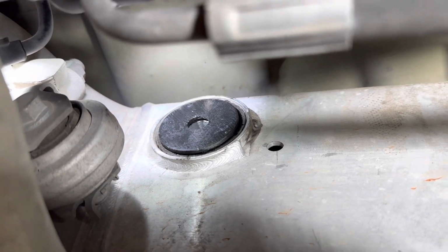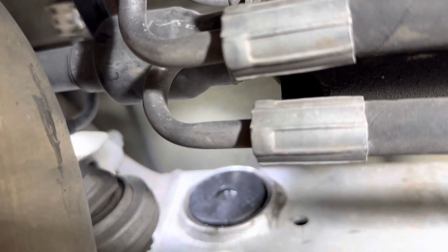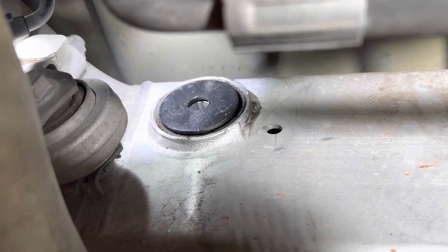I just took a very mild hammering, and then at some point, I just ended up using the pry bar and pushing up against the sway bar here, and I just pulled on the bar, and boom, it just slid right in. So perfect. All right, so the next step is going to be to torque down that bolt. It's 175 Newton meter or 129 foot-pounds.